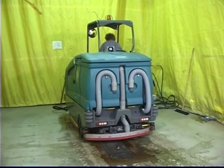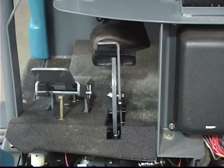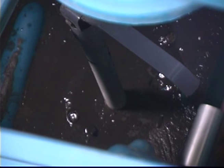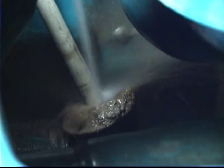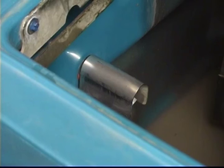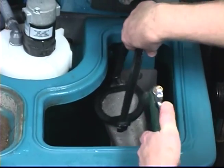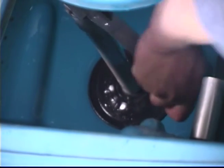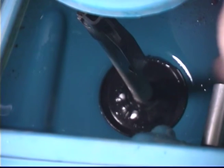Reach into the recovery tank and lift the handle on the drain plug assembly to loosen it. Lift the drain plug assembly out of the drain hole and place it to the side. Now you can rinse debris off of the drain plug assembly, away from the drain hose and out of the recovery tank. While rinsing the recovery tank, also rinse off the float sensors. If your machine is equipped with the ES option, also clean the ES filter. Next, install the drain plug and fold the plug assembly handle down to secure it in place.